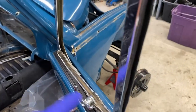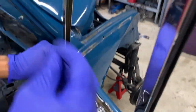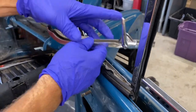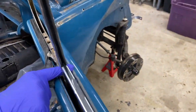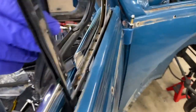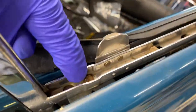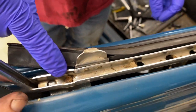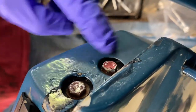With that screw out, the whole top is open and you can swivel the vent window — it's just on a post, so you can get it all out pretty easily. When you take the rubber that's in that space and peel it back, you can get in to a bolt on one side and a screw on the other. There are also two more fasteners right in there. That little one is like an 8-millimeter.